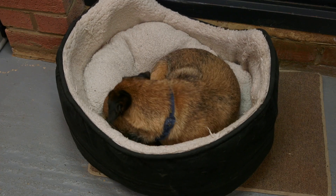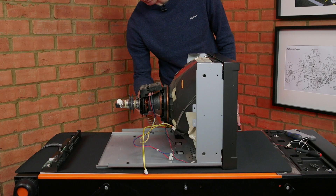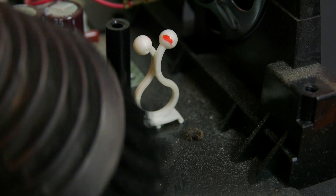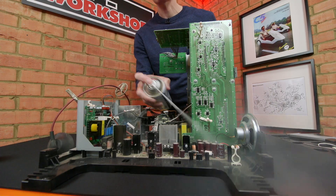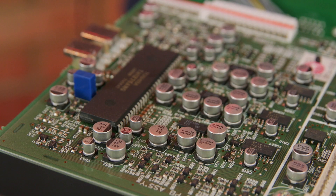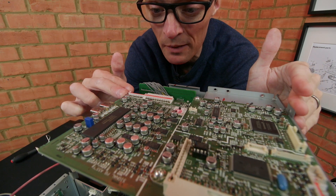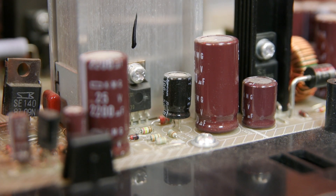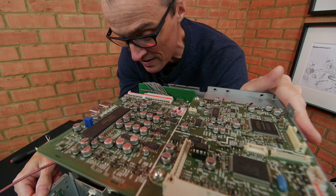With the monitor partially reassembled, Frank's got his bed back — but he won't be resting for long as I've got the vacuum cleaner out to give the monitor a quick clean before I reassemble it. I then used a spray duster on the circuit boards. Like any CRT monitor we've got a whole heap of electrolytic capacitors — both small surface-mount caps on the control board and full-size electrolytics on the main power and scan boards. I'm not too concerned about the state of the caps because we've already seen that the geometry on this monitor is pretty good, which suggests the caps are okay.